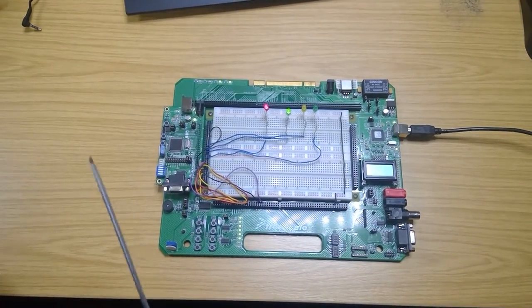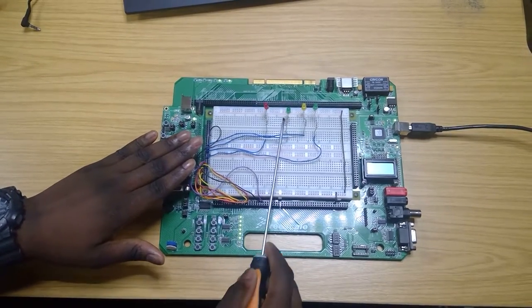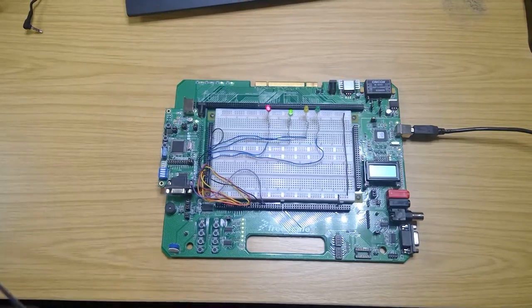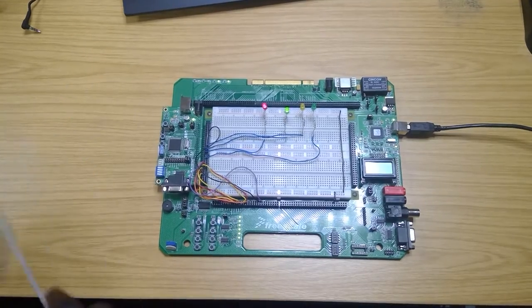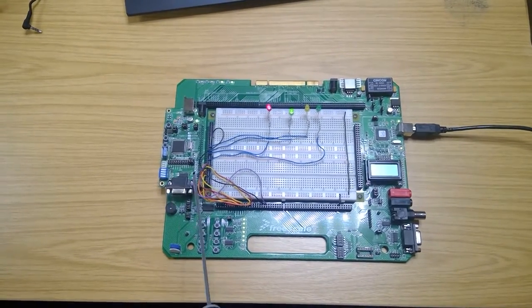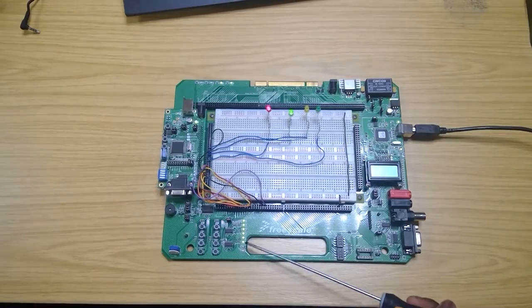Let's test the weight again. As you can see, the washing cycle stops again, causing the red LED to blink. When the weight is back below 5 kg, the system cycle gets reactivated, and the target temperature is saved.